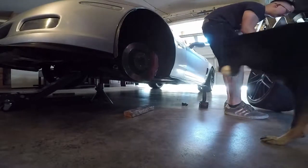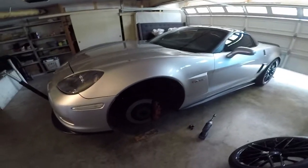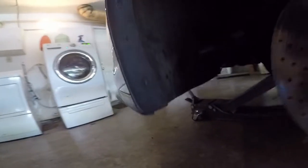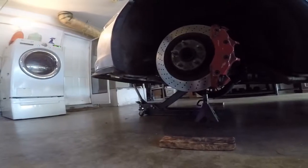It kind of seems like a little bit of a pain to just remove the wheel in order to get the fog light, but as you can see, the fog light sits right here and where we need to get into it is from back here. Underneath, as you can see, there is no room for you to get your hand in there. I tried it, it didn't work out, so I'm going to go ahead and pull this panel off.